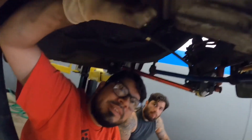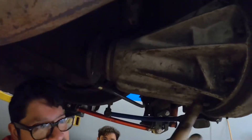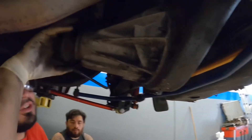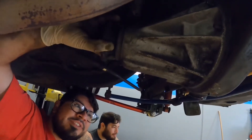No preload on here. What does that noise mean? It's got a lot of play — they didn't set the backlash. The pinion goes here and the ring gear goes around, so they have to set the backlash and it's essentially unset. So that's your noise right there.